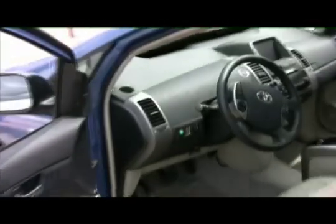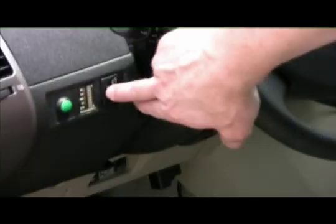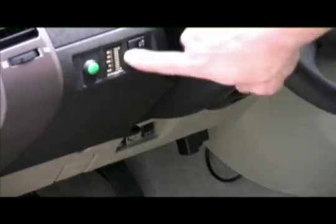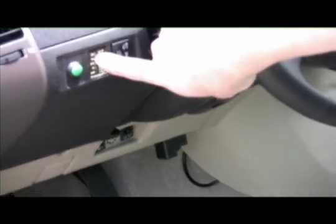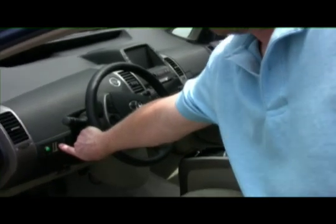We'll start in front with the additional devices that you'll see here. The first one is the EV mode button. And this is the display that we put in. The AC means it's charging — it's plugged in. If it's on continuously, it's in charge mode. If it starts flashing, it's charge sustaining or balancing.